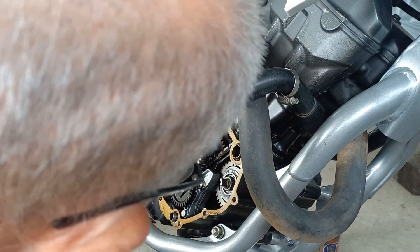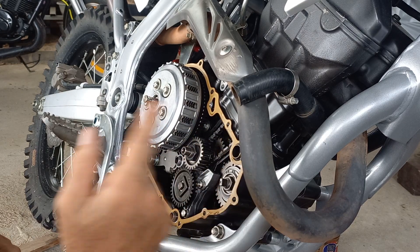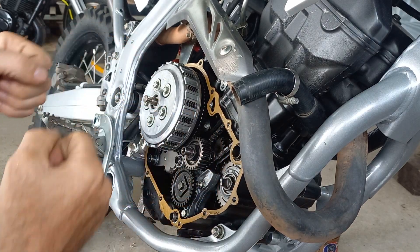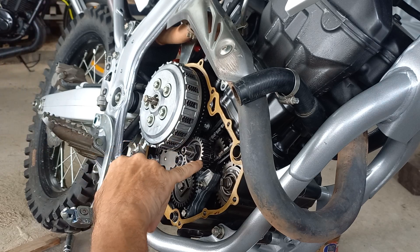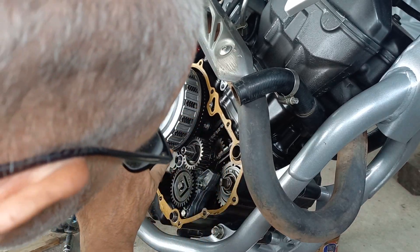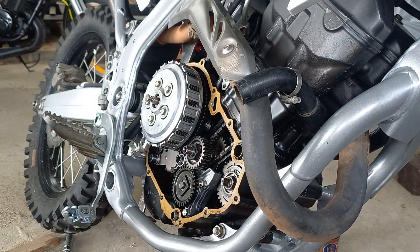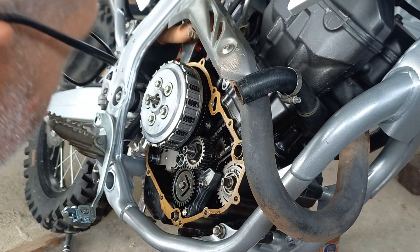In a dream at five o'clock this morning I thought: the obvious way to spot that, if there wasn't any backwards and forwards play — which there isn't — would be that your main drive gear from the crankshaft to the clutch basket would be over here and it wouldn't be meshing with each other. So I'm looking in there now and it does look to be completely in mesh and not sort of hanging out this side, so that's a good thing.